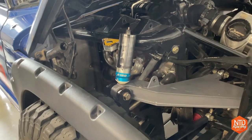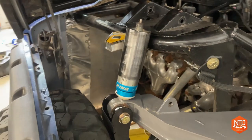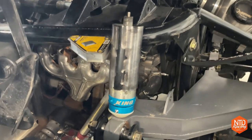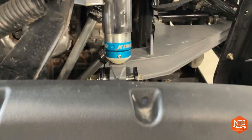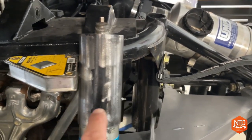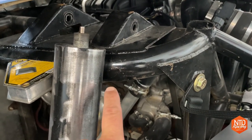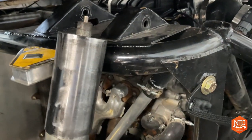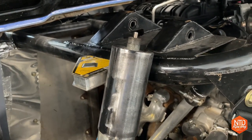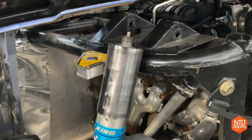I have the bump stop located exactly where I want to put it. It's going to land pretty much on that uniball right there. I'm still going to be welding a plate on top of that plate right there — another 3/16 plate that goes on top — and the bump stop is in line with the travel of the suspension as it goes up. What I'm going to do now is take the plates, locate them in position exactly where I want them, mark them, take them back into my weld shop and put a couple tack welds on. Come back out with the bump stop again, tack weld the other plates on, tack them all the way around, go into a finish weld.